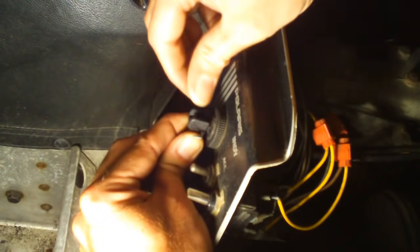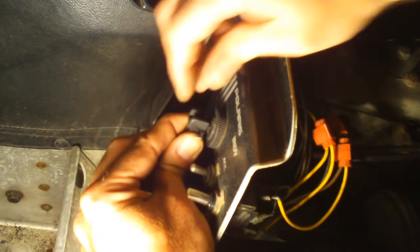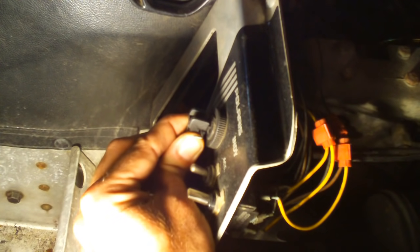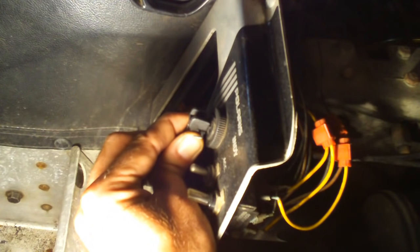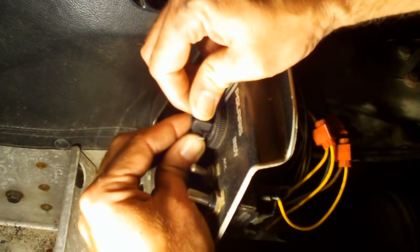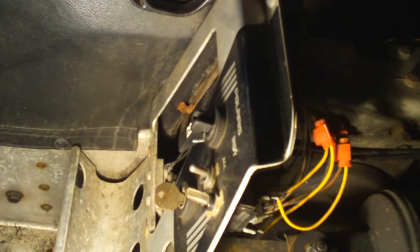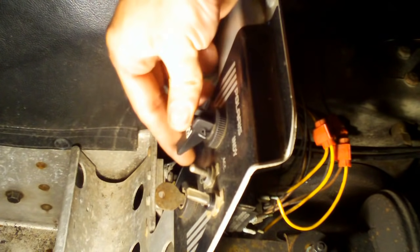What I'm going to do is hold this lever out. This is a bent nail being used — I lost the pin, so I improvised with this bent nail, but it's good enough for now. Now we want to adjust the second carburetor by turning up on the barrel adjuster until it starts to pull that lever in. There it goes, it's pulling the lever in. So I'm going to back it back off. There it's set with the first carburetor. I've turned it back in about a half a turn and it's back to where it was at one-eighth of an inch of play.